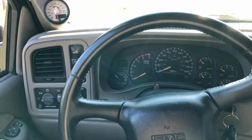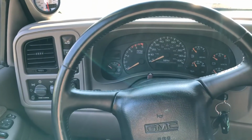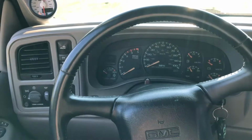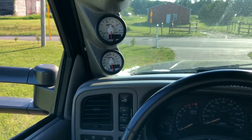One of the issues I had with this tuning is I had to drop down my fast fuel pump to run at about 7 psi. I was getting a little bit of surging. It was kind of kicking back on the fuel pressure regulator. So that was another tuning bug we had to work out.